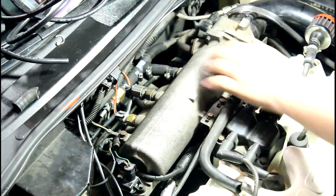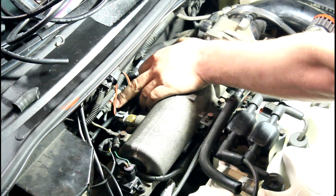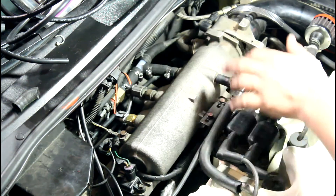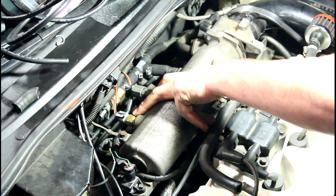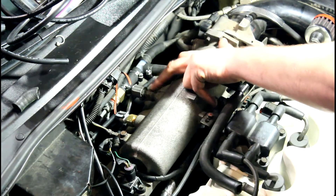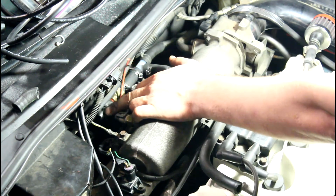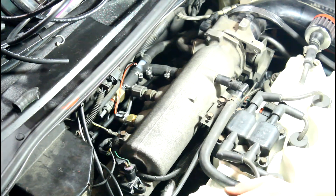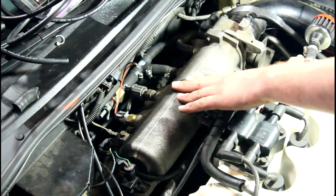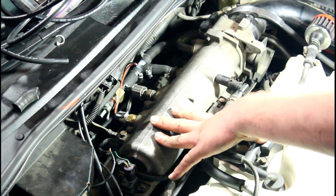This is what I ended up with. I split off here — it goes to the brake booster. I split vacuum off of that and put our original splitter in; that'll supply vacuum to everything else including the MegaSquirt box, my boost gauge, and things like that. Got this GM intake air temperature sensor threading right in where the splitter came out, so that's all good. We'll leave the stock one as a plug — not sure if we'll use it on the stock ECU. The vacuum from here goes to the MegaSquirt's MAP sensor, one of the other sensors it needs to run the motor. Just make sure it's on this side of the throttle body so that when the throttle blades close, you still have a vacuum reference of the manifold.